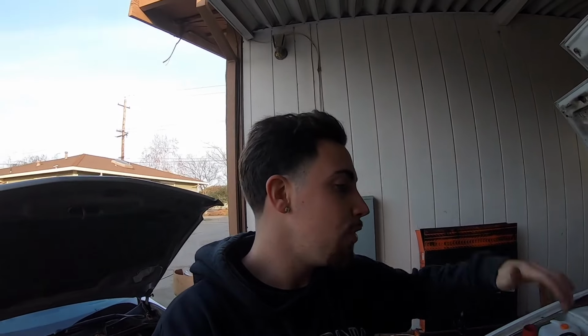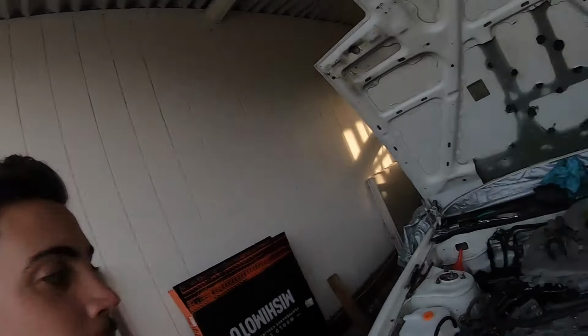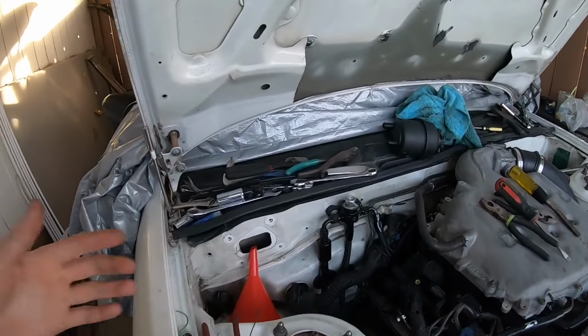So I can't finish out the video without telling you guys exactly what was wrong with the car. As you guys saw throughout this video, I replaced one thing, I replaced another, and we had no luck. Everything from the fuel pump to testing injectors, testing for spark, testing to see if we're getting fuel, all of that stuff, everything was good and we could not figure out what the hell the issue was. The issue was my fuel pressure regulator right here.